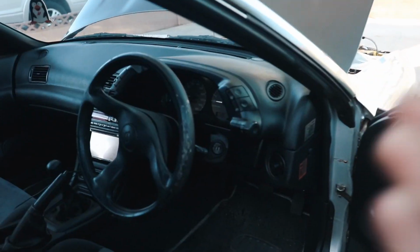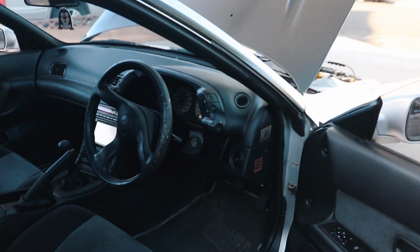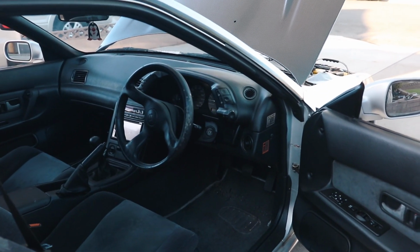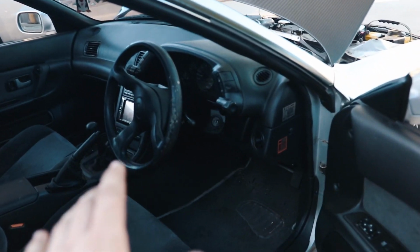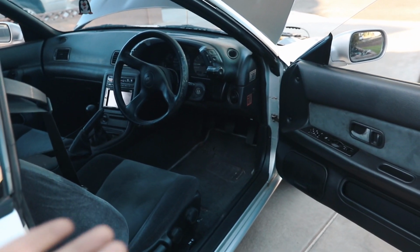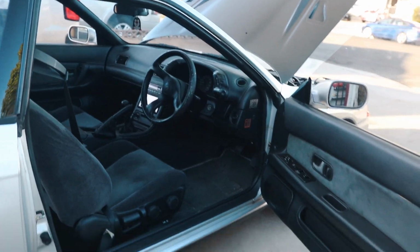So as you guys just saw, we were getting 14.0 volts, which is good. That's where it should be. It should be anywhere between like mid 13s to like 14.3, maybe 14.5. I think 15, anything higher than that is kind of dangerous. Typically, you're going to be between 13.5 and 14.5, and we're pretty much right in the middle. So that's great.